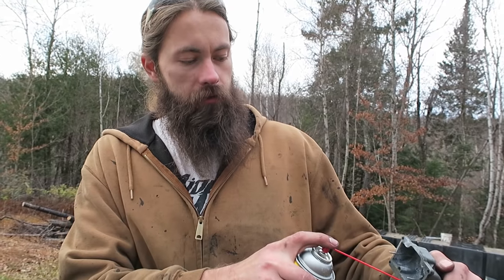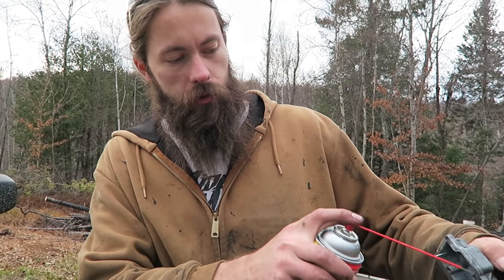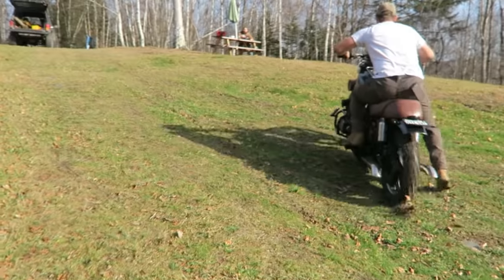That white stuff is aluminum oxide. Ethanol corrodes it all. You can see the pitting. More modern sleds use a different alloy in their aluminums that's resistant to the corrosion, at least, not the gumming. That's why this one was white and the other one was like green.